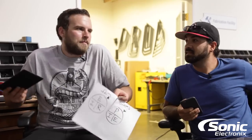And the general rule of thumb is if you have 1600 watts RMS, you probably want to run a 180 amp to 200 amp fuse. They don't make a 180, but in general, let's say you have a 1500 watt RMS amplifier, you want to run a 150 amp fuse. You can just do it that cheater way. It's probably going to be a little on the larger side. Take the wattage and add a zero. No, subtract a zero, fool. Oh yeah, take a zero. Add a zero, they don't make fuses that big. A 16,000 amp fuse. But that's a pretty easy way to roughly figure it out.